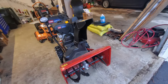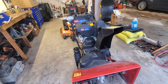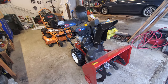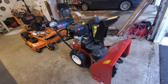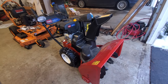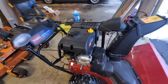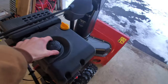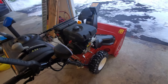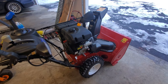Today I'm going to be working on this snowblower. A lady near me has had it for a while — she thinks it was used once and hasn't been used in about two years. It's not running now. I went over there to snow blow her driveway and she said it wouldn't start, so I'm thinking it's just bad gas. This thing is full of gas and the gas was on when I found it in the garage, so I'm pretty sure it just needs a carb clean.